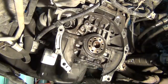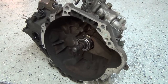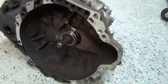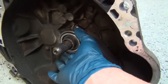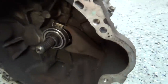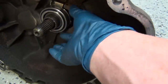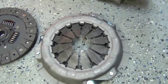I think this is about all I'm going to do on this clutch video — you kind of get the idea. I might show a little bit of the assembly as I put the other one together. Here's the transmission — this is the bell housing, this is that input shaft I showed you. What I didn't show you is the way that we push on those levers is with a clutch fork. Most cars will have a clutch fork. This is a Toyota, so it actually makes sense — it's a good quality design. The clutch fork is like a teeter-totter: when one kid pushes down, this kid goes up, and when this kid pushes forward, it engages those levers on the pressure plate.